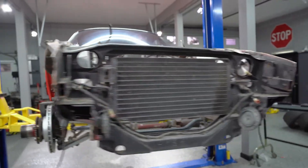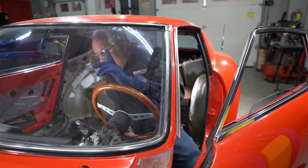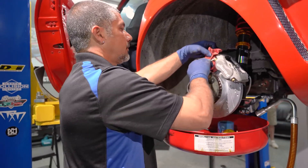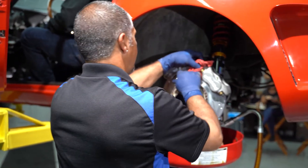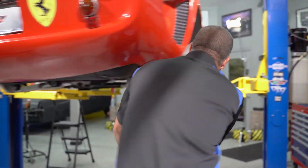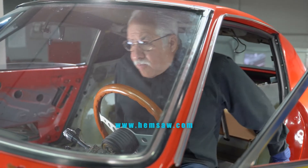What we're getting ready to do right now is bleed the brakes. Sam's going to be watching the amount of brake fluid in the bowl while I add pressure by pumping the brake. I'll pump, hold it down, Sam's going to crack the valve and then close it, and then I'll do another couple pumps and hold it all the way down — we're wanting to bleed all the air out of the system. It's important you always start with the line farthest away in the back and then work your way forward. There are vacuum pumps out there you can hook up to air and suck the fluid through. If you didn't have a bench bleeding kit, that's something I highly recommend because it'll cut your bleeding in half. But I always recommend at the end you do one manual pumping like we do here, because it just works better at the end.